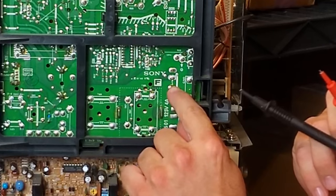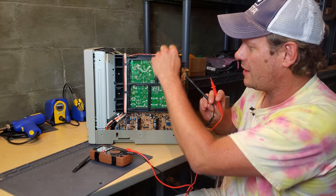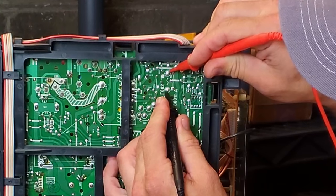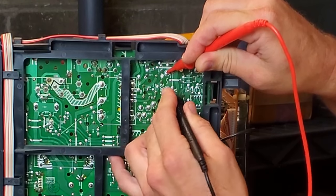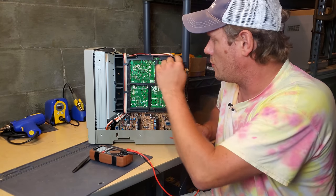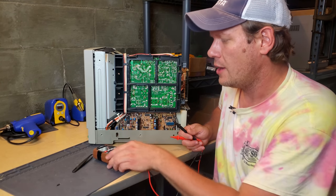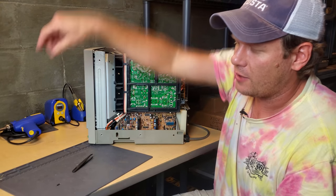Just remember that the little squiggly line right here indicates the fuse, and you need to test one side - the top and the bottom. And if we look up here, we'll see where our connection point goes in from our monitor. If we look down here, we see F602 - that is our second fuse. So we'll do the same thing here, only it actually has points on it where it looks more like a through-hole component. It looks more like a resistor or a diode. And if you notice here, I am touching these together - and I'm getting nothing. No current is going between these two points. That fuse is blown. And when that fuse is blown, the monitor will not turn on at all. So what we're going to do now is remove this fuse, install this salvaged fuse, run a current check, and then ultimately power on the monitor. So I'm going to need to remove this board and then get set up from the overhead view. We'll do some desoldering and replace that fuse.